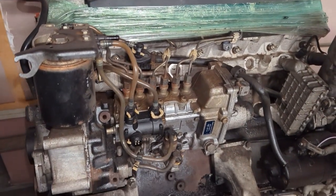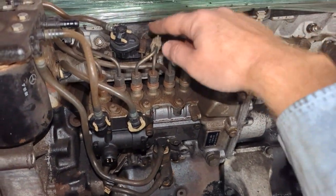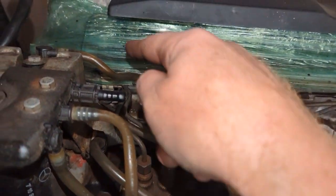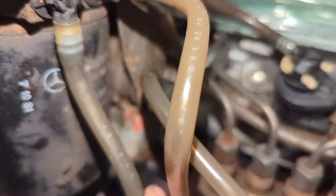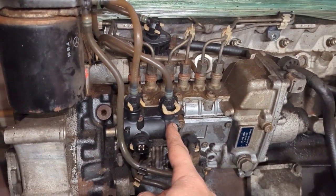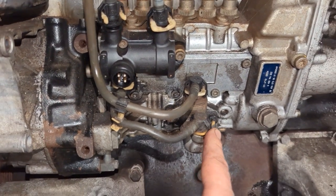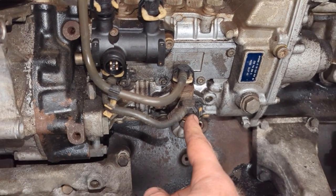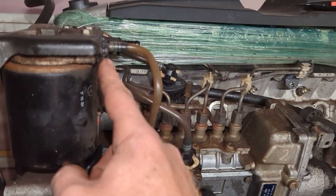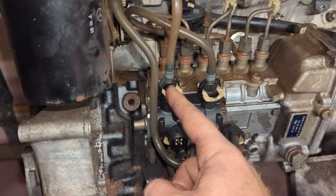First let me explain how the fuel is routed. Your fuel comes in on this hose from your tank, it goes to this fuel heater on the cylinder head which uses hot coolant to heat the fuel, then comes out into this pre-filter. From the pre-filter it goes through your shutoff valve and then to your lift pump, which pressurizes the fuel. It gets sucked in and forced out into your fuel filter, gets cleaned, and then goes into your engine.